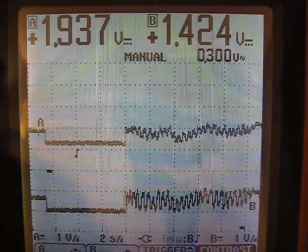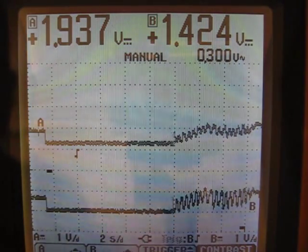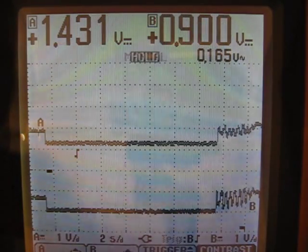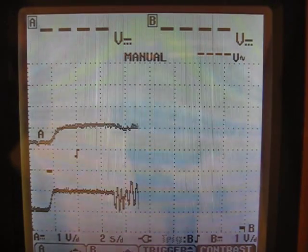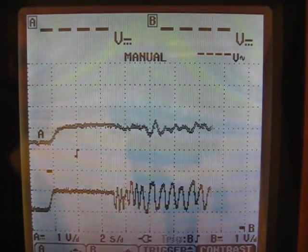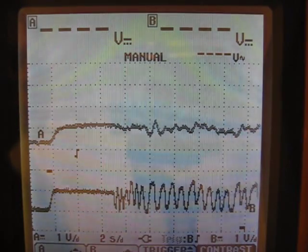But as a side effect of this, it is going to create more of a delay in the throttle rise time. Let's do a reset — now I have a lot of buffering in here. And you can see the throttle comes up a little bit slower than it did before. And here's the jiggling — even with a slow jiggle, it takes quite a slow movement to get any kind of output movement compared to the input.